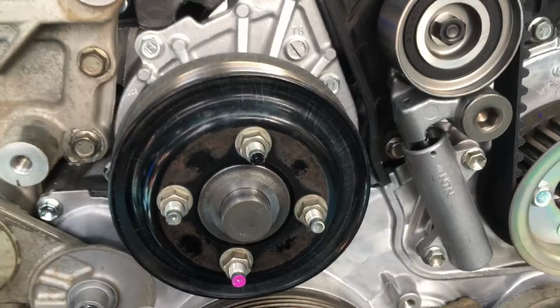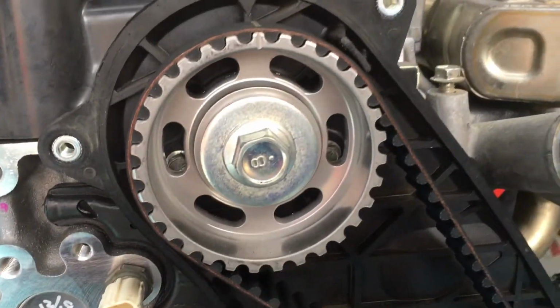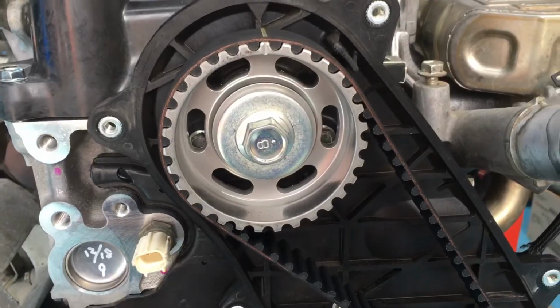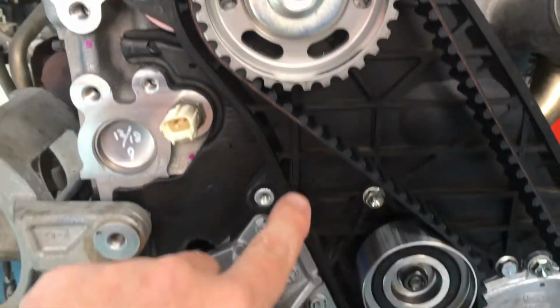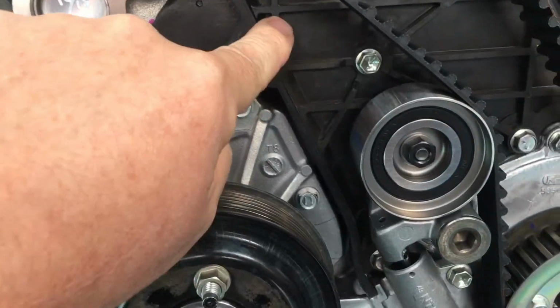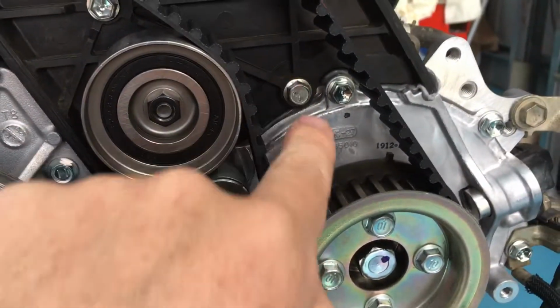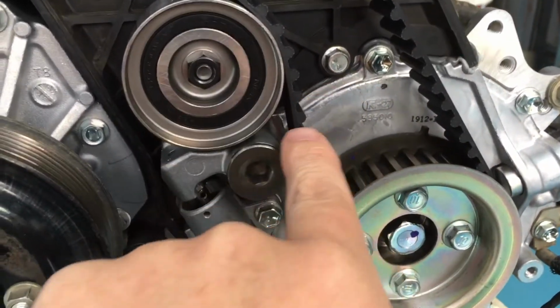Over this side, obviously, it's as per the timing belt videos then, putting it back together. The procedure, so that you don't have any issues, would be, don't forget this insulation that goes in behind, that goes in first. The second thing is the backing plate. So you've got either nuts and bolts, there's one each side behind the pulley there. There's another one there and another one here. Little bit of RTV silicone along the bottom there.